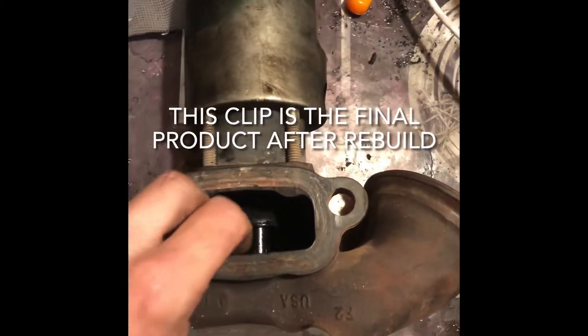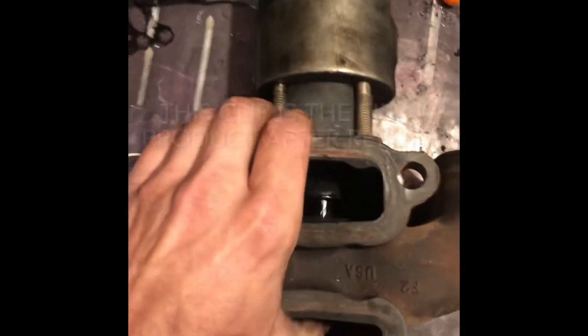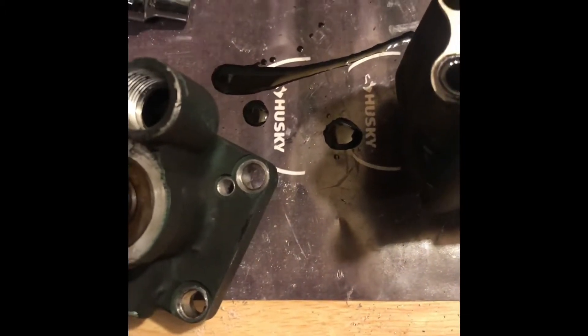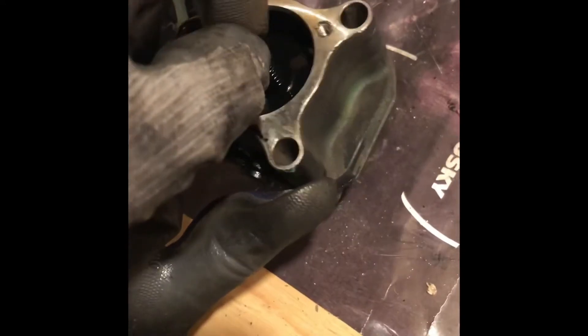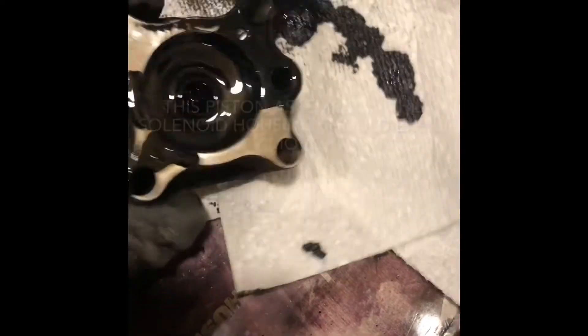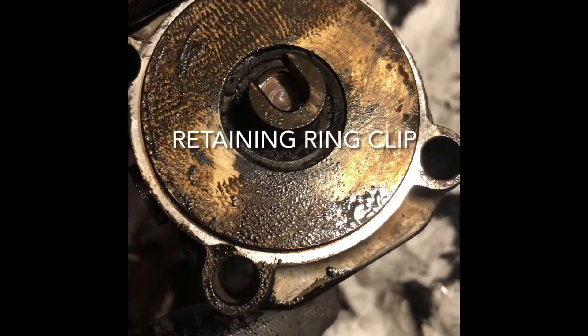Here's the completed part. This bolt is three-eighths. Just a solenoid — clean that up. On top of this, right there, that small hole — nine-sixty-fourths was the Allen wrench I used. There's one on each side. Pull this apart and we're into it. Looks like I can just lift that spring out of there. That should be so easy to push around that the little spring in there just pushes it right back. Going to go ahead and pop that off and see what comes out, see if we can clean it up.